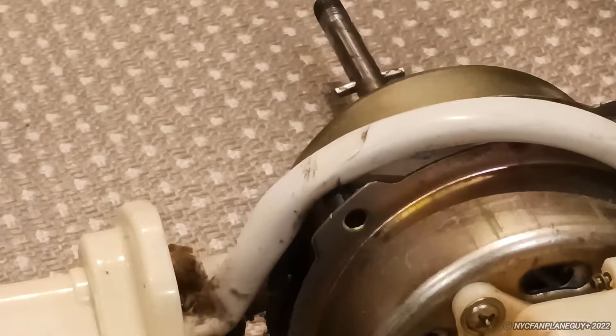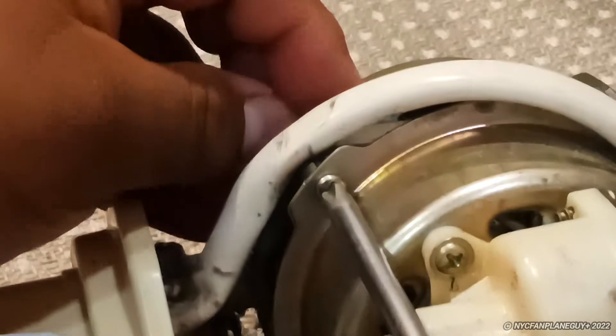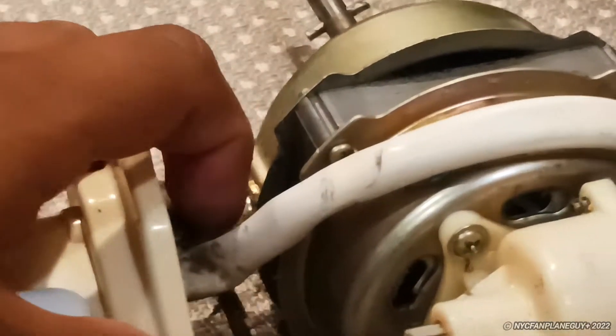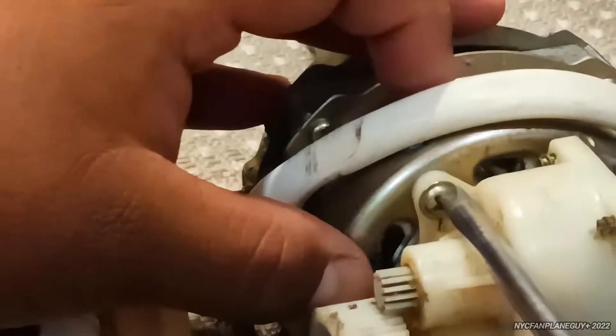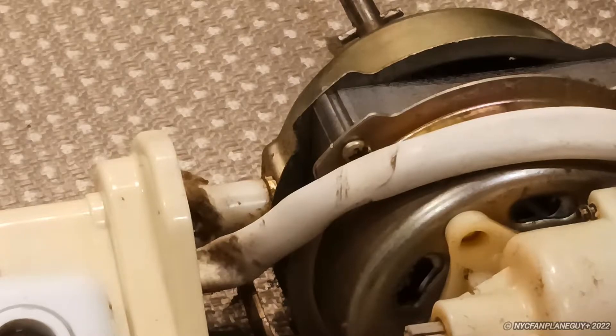There you go — that's the piece that's been causing trouble with these SMC fans. I don't know why they designed it that way, but I got it out. So now I'm going to move to the gearbox, and this will place the power cord away from any parts of the motor that were probably not deburred properly. I'm going to need to move this screw out of the way, and I have a set of plastic cable locks right here.